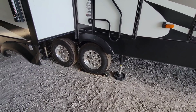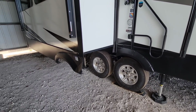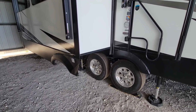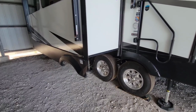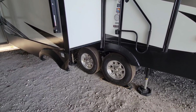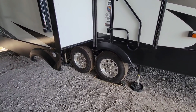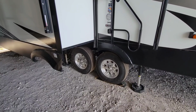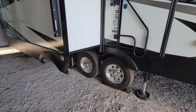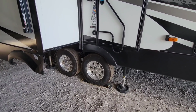If you have them on a hot shot style trailer, you very well may be loading, like I said, a skid steer or an excavator that has to roll from the back to the front, and it's going to put a much greater load on any of those tires at any given time, depending on where that tractor is. And that's something you always have to account for, right? You have to account for where the weight is, where the weight's being placed at that specific time, and where that weight might be transferred to.